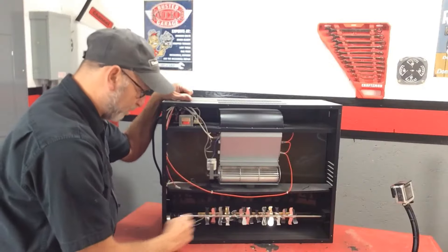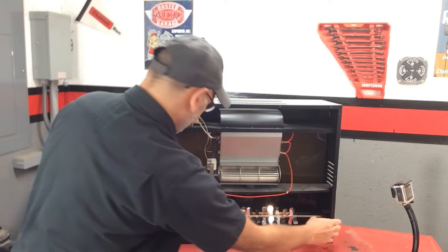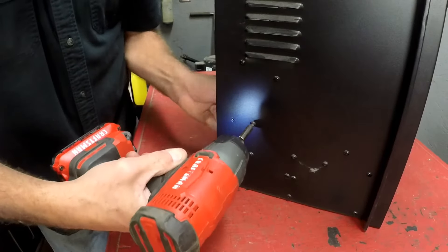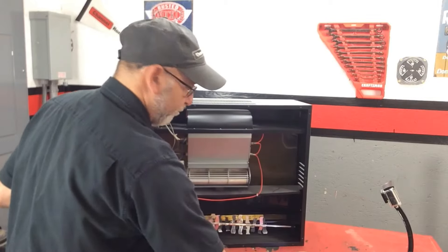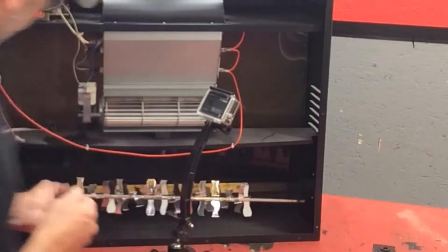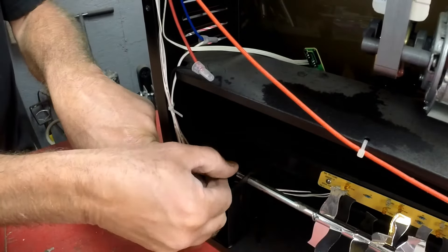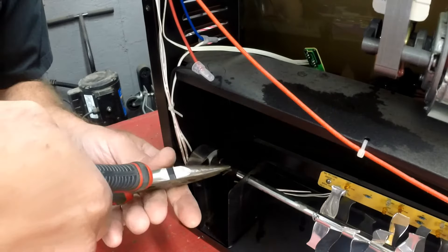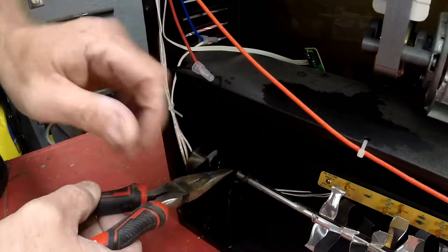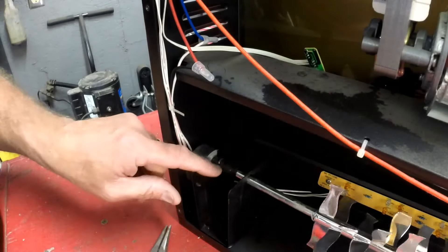In order to get this motor out of here I'm going to have to move this little reflector. I've got some screws on the back side and some on the bottom. I'll remove this here first — I think that's going to be easier. So we'll take these screws off the back. That's going to allow me to pull this out. And then all this is is just a clip, a pin that goes straight through. So we're going to bend that, take a pair of needle nose pliers, straighten it out as best we can, and push that through to the other side. Should be able to pull that out — there we go. There's the cotter pin, and now we should be able to pull that right out of there.